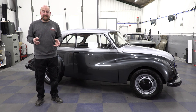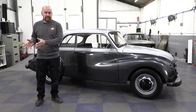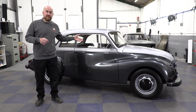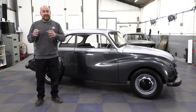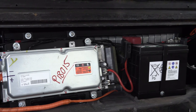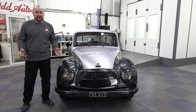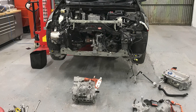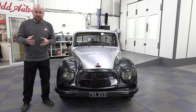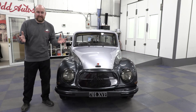What a DC-DC does is basically like a car's alternator. So you've got 400 volts in the high voltage battery pack and you still need your 12 volt battery to run things like the lights and the heater. This DC-DC takes the high voltage, drops it down to 13.5 volts, and charges a normal car battery. The motor out of the Leaf was about this big — doesn't weigh much — and it's water-cooled so it needs a radiator, but doesn't produce that much heat so you don't need a fan; it just radiates the heat itself.